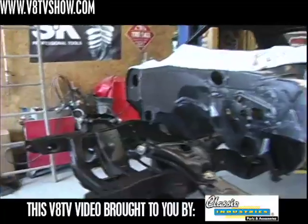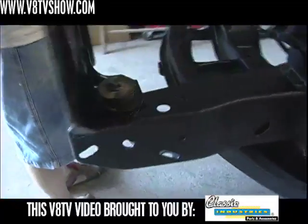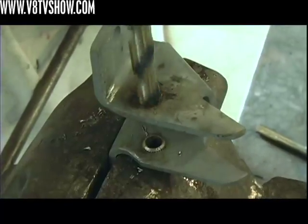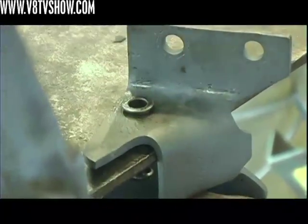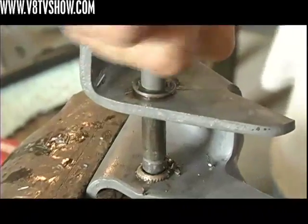So we were making progress on our '69 Pontiac Firebird Routy project. The next step after the subframe was attached to the body was to start fitting the sheet metal to the car. The first piece was the original radiator core support, and then Nathan moved on to the doors. He began by rebuilding the door hinges to make sure that they open and close properly without any play in the pins and bushings, because you can't get the doors to align if you've got sloppy hinges.